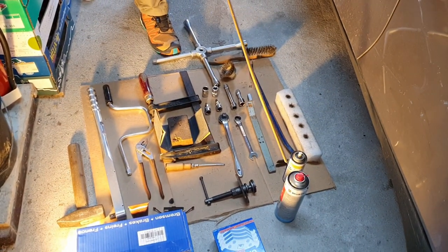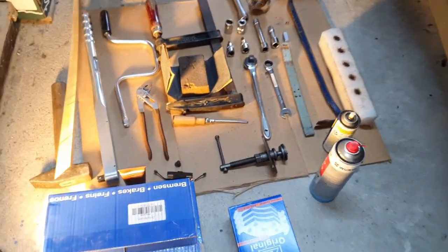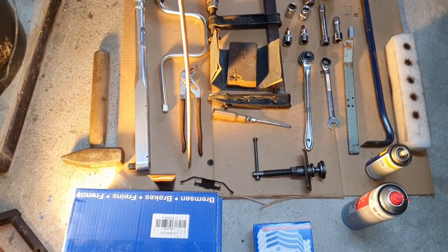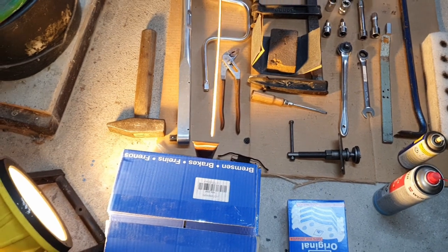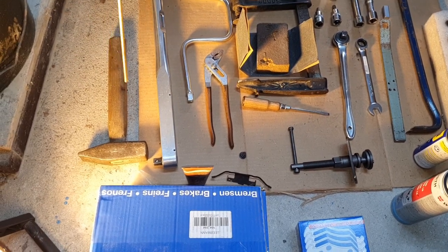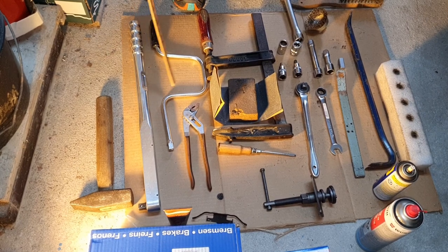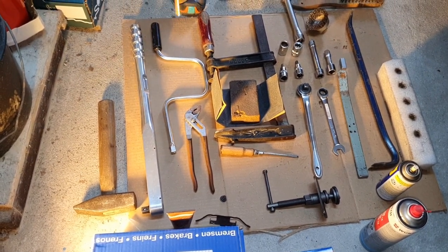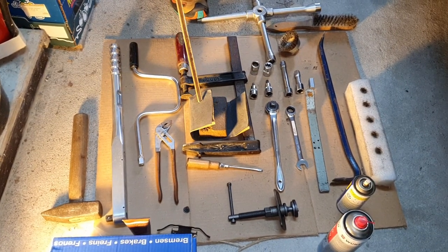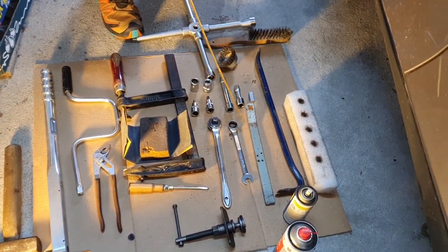In this video I'm going to show you what I used for the repair of the rear left brake on my BMW i3. I'm going through all the tools. First I'm pointing at the metal anti-seize compound. After that, this is the torque wrench — you need to torque to 140 Newton meters. I also used the hammer, a pipe wrench, and sandpaper — it's 120 grit — and a small flat head screwdriver.